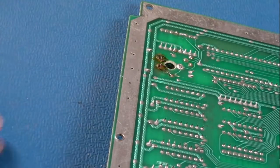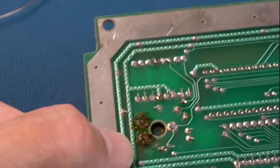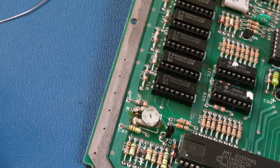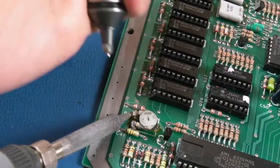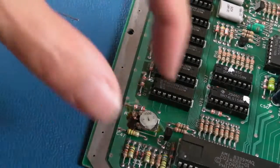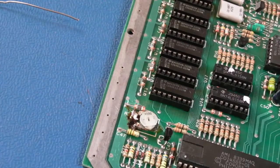But you know what? It doesn't need to be on that side. So yeah, it didn't need the huge, you know, that'll clean up in a minute. It looks charcoal, but there's no pads there. This is why someone's put huge amounts of solder here, because this is where the pads are. But again, we don't need huge blobs of solder. I think that's it. This side over here is not too bad, so I'm just going to leave that as is. But we'll now just clean up.